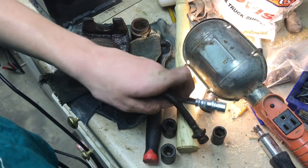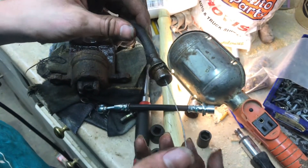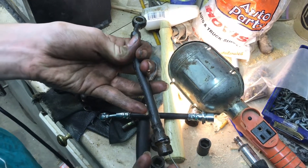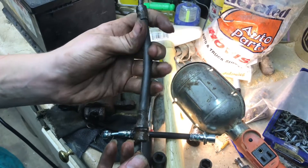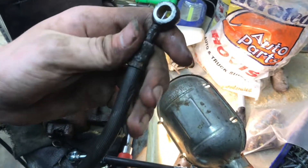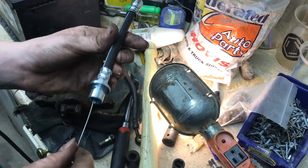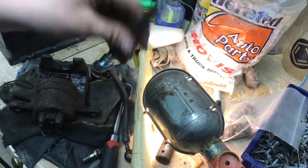Let's go ahead and take out the banjo bolt and the caliper hose. We have a new hose and an old hose here. I'm going to take the old hose and carefully run a wire through it just to feel if there are any blockages. We have the wire tip sanded down to make sure it won't puncture the side, and it just flowed through really easy. I'll pull it back through and as a control group I'll test it on the new one as well, and that flows through about the same — the hose is not the problem.